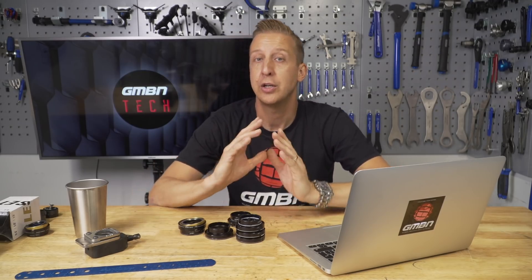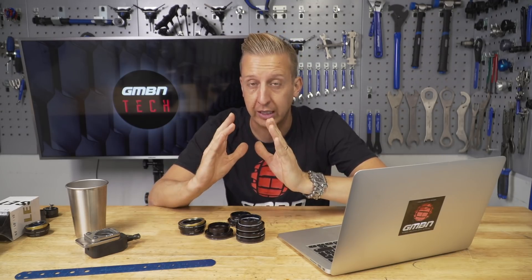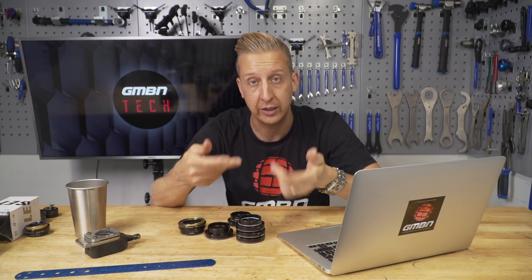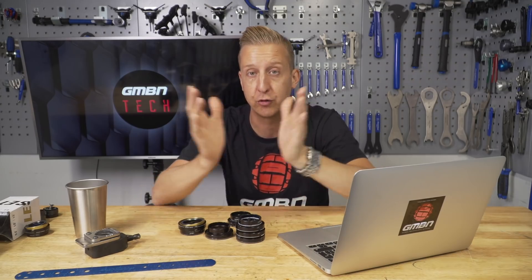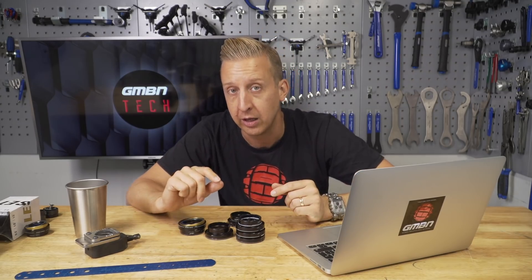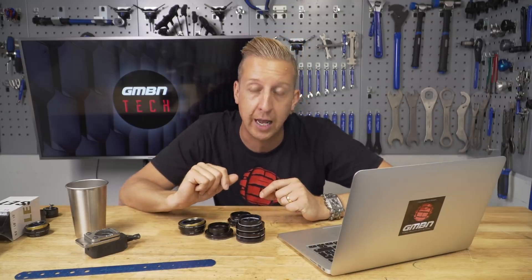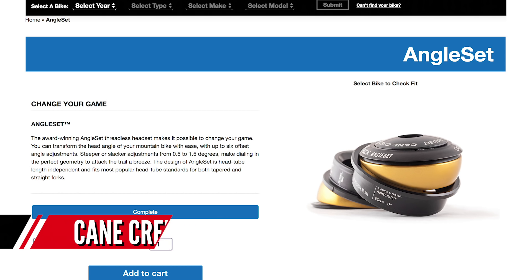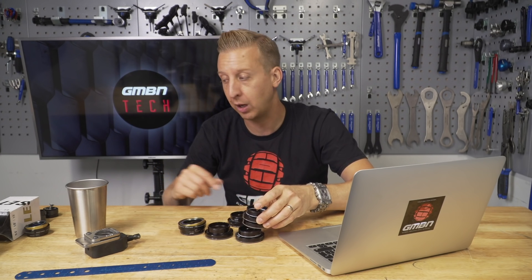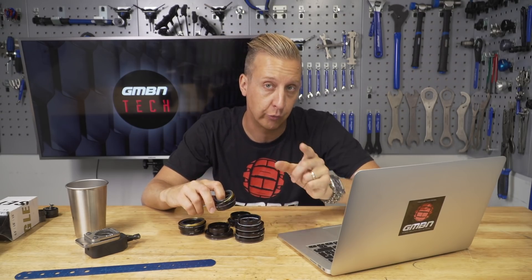It does work, but you have to factor in how your frame is made and what sort of head tube you have. You get regular tapered head tubes, 44mm, internal bearings, ones that accept external bearings, 1.5-inch, and of course traditional old-school inch-and-an-eighth. You can go to the Cane Creek website — I'll throw a screenshot of their calculator on screen now. You basically put in the bike you have, the fork you have, and how much angle you want to add or decrease, and it tells you what combination of lower and upper cups you need and even whether it's compatible in the first place. Really useful tool.